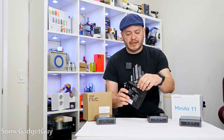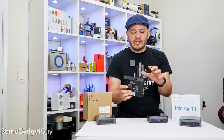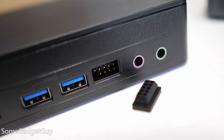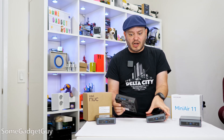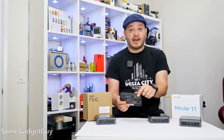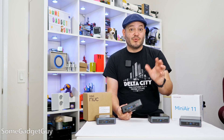You might have noticed as I'm moving this around, there's also a 9-pin header. So you could dock this PC in a setup where you can't easily access it and then feed some other type of control surface, or even just an array of LED lights so you know what's going on with the computer — you could move that to the front of your monitor. There are some good reasons why an IT department would like having this header, but I do find it strange that it seems to come at the expense of other functionality for the front panel — we could have gone with the joined 3.5mm single headphone connector and included that USB-C.